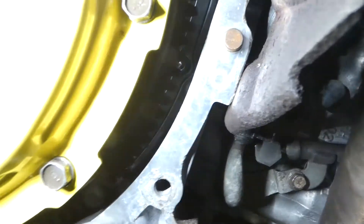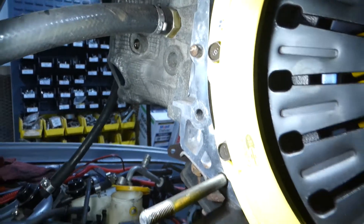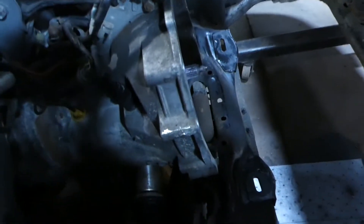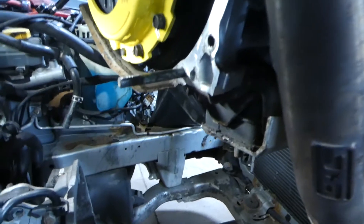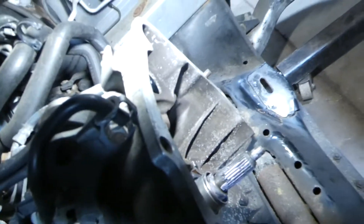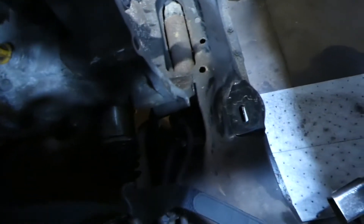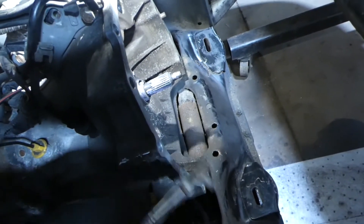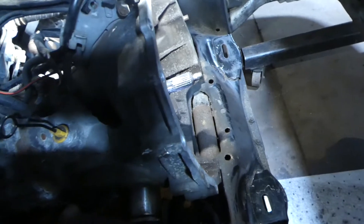A little hiccup when I was dressing the block — I noticed both dowel pins were still in the block, so I thought great, all cleaned up and ready to go. But I forgot this is an aftermarket IAG block, it didn't come out of this car. So of course both dowel pins are also still in the transmission. With a little heat, a little hammer, and some forceful love we'll get these out, stab the transmission in, and this thing will be in.